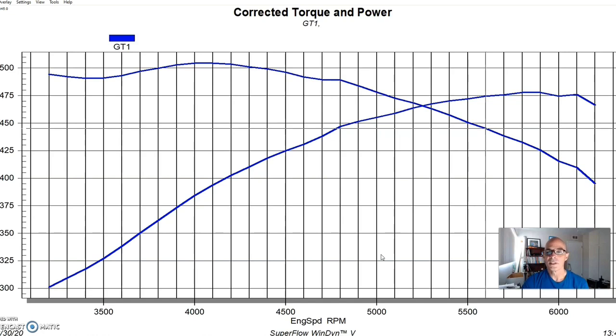Comparing the Z head to the GT40X: the GT40X had a 178cc intake port, a 62cc exhaust port, and was available with either 64cc or 58cc chambers with a 1.94/1.54 valve package. The Z304 head had a 204cc intake port, an 85cc exhaust port, a 63cc chamber, and flowed 275 CFM with a 2.02/1.60 valve package. So the chamber size is essentially equivalent to or slightly larger than the GT40X, meaning any power gains we see are really from the improved port flow.